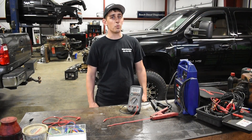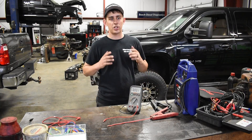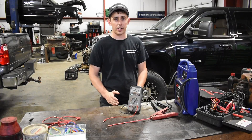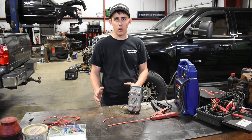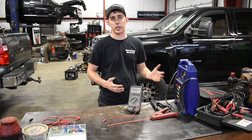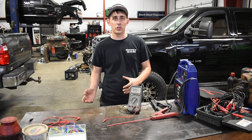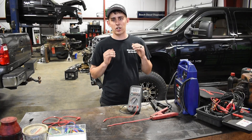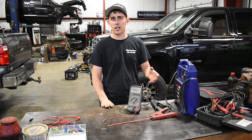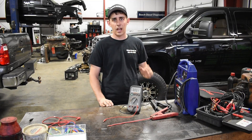I commonly see two big mistakes in the shop. The first is not properly checking your fuses — check every single one. I've seen people just check the fuse for the circuit they're working on, and it turns out there was another fuse blown somewhere else in the system. Replacing that fuse fixed the circuit. A lot of manufacturers use really complicated circuitry and rely on multiple fuses for the same system, so check every single fuse first. There are multiple fuse boxes in a lot of these cars — some are hidden under the dash, some under the hood, and some are even in the trunk on certain European cars.